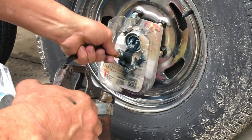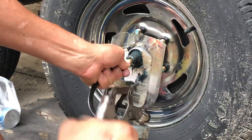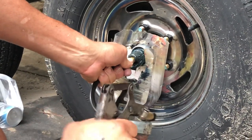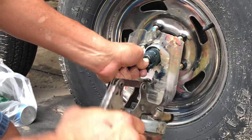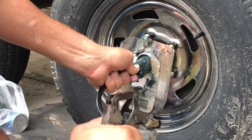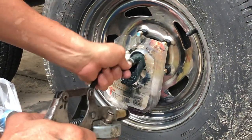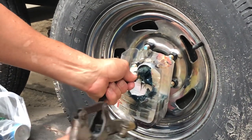I see some blue grease. I use marine grease — it's supposed to be waterproof. I don't know if it makes a lot of difference, but it seems like the water does not mix in with it. But if you don't have it, one of my favorite sayings is: some grease beats no grease. So if you don't have marine grease and you just have some kind of wheel bearing grease, put something in them. Do not run them dry.